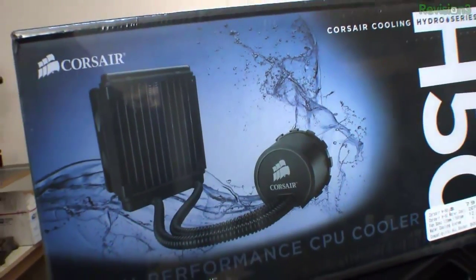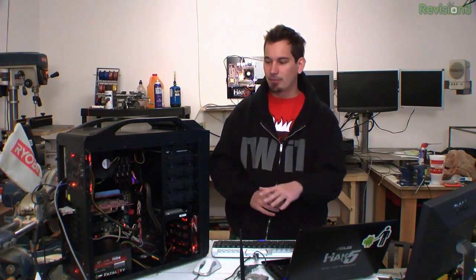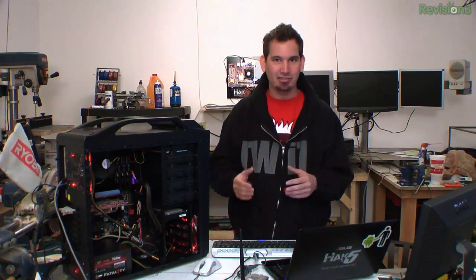This has led me to what we're also going to do — working with the Corsair H50, as we talked about last week, doing a little bit of water cooling. I thought it would be awesome to pop a Core i7 920 in here and overclock it to 4 GHz. It's totally feasible, and if I had spent a little more time researching the motherboard, that would have easily happened. I got a 920 in here using the EVGA FTW-3 — the X58 For the Win 3 motherboard. I can do the overclocking just fine — I've gotten this thing up to 3.8 GHz with air cooling and haven't even unboxed the water cooler yet.